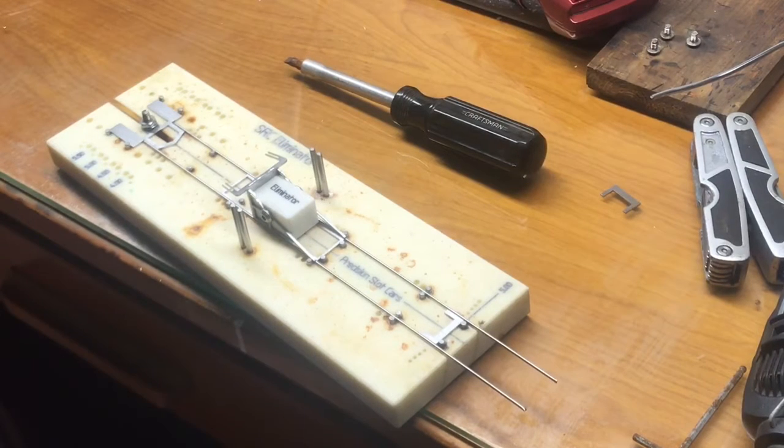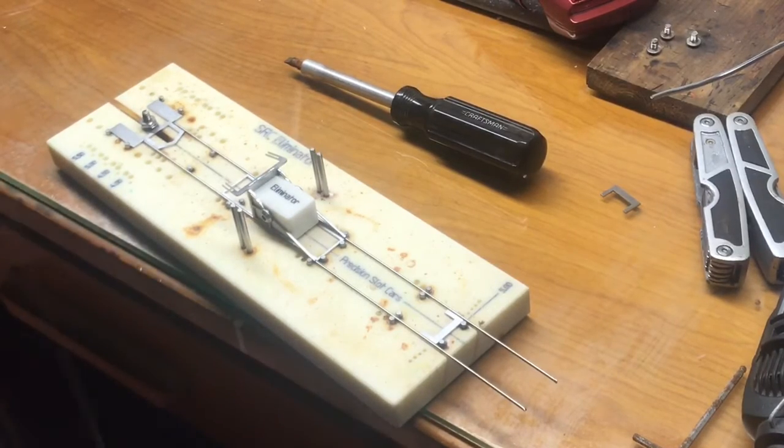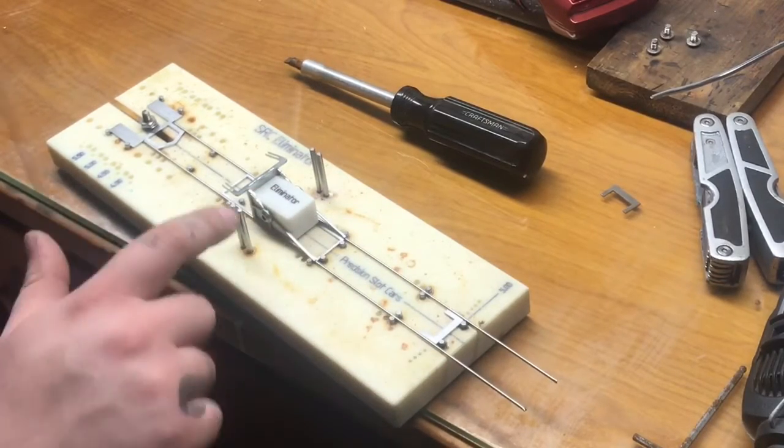In a bracket car, you're never going to know the difference, but if you're trying to build an all-out top end, like a heads-up car, then the tubing would be the way to go, just to save that extra little bit of weight that you can. But I will go ahead and cut this up here and show you how I get it all fit up from the main rails, basically the same thing, and then the down struts for the rear and the front.